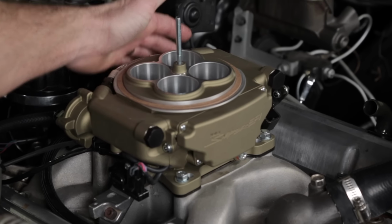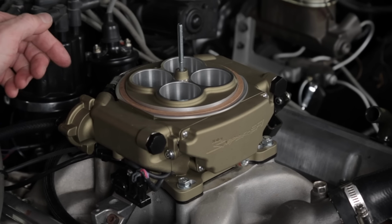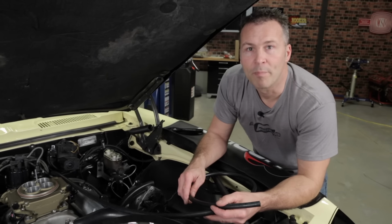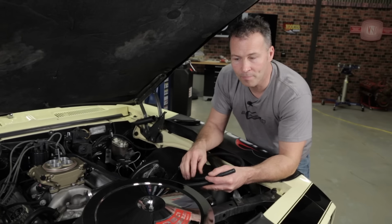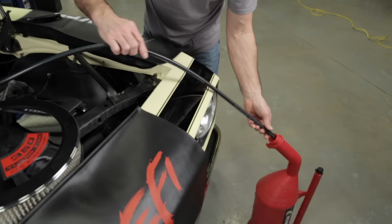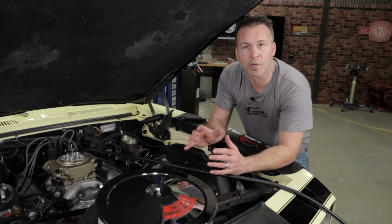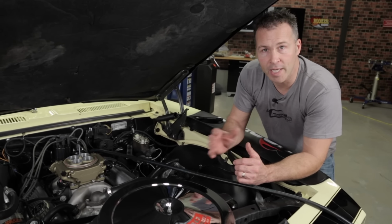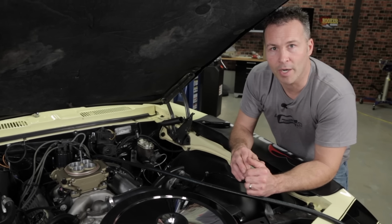There are 3 inlet options on the Sniper throttle body that you could connect your supply lines to, but it's important that the return line is only connected to the -6 fitting found on the fuel pressure regulator. Before we can connect our supply line to the throttle body, you'll need to flush the system. I find it easiest if you leave yourself a little extra hose and run it directly into a gasoline suitable container. Flushing the supply line prevents debris from clogging the injectors, causing poor starts, rough idle, poor performance, and even injector failure. We'll come back prior to startup and finish our connection at the throttle body.